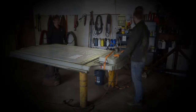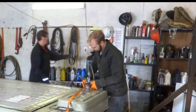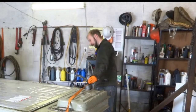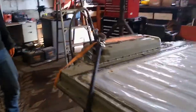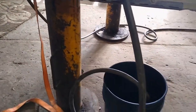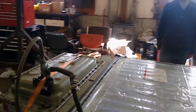So Brian, what we got going on here? You're getting the fluid out of it, eh? Yeah, so I pulled the coolant quick disconnect off of our rack and just attached a hose into a catch, and we're just gonna run some air through it and try to pump all of the coolant out of the modules into our bucket until it's gone. Yeah, and it's much better for transportation that way, right? Yeah, well, we're gonna dissect this thing, and so we don't want coolant flowing everywhere when we're pulling them out, and it's just much better to have it clean and dry.